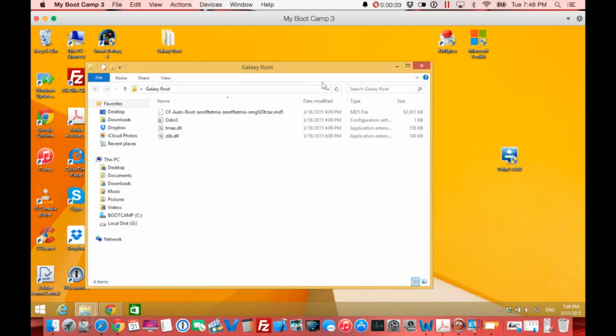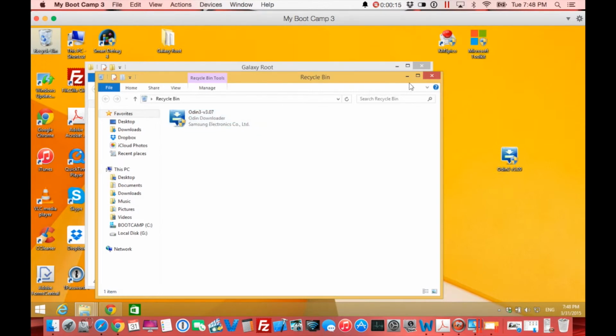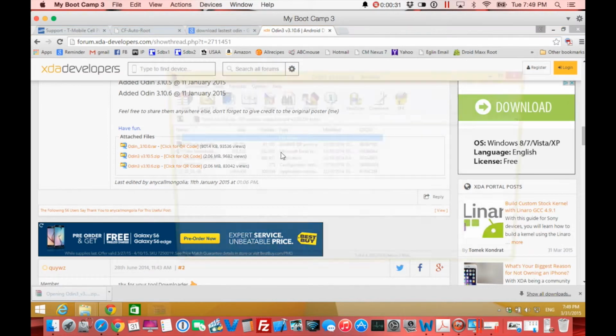So I hit a snag, but it's good that I did this before you. When you download this folder from Chainfire, it's going to have Odin version 3.07. Just go ahead and delete that version of Odin, and you have to download the latest version. So again, the link will be in the description. You just go here and get version 3.10.6. That's the version you need. You download it, and we're going to go ahead and open this.